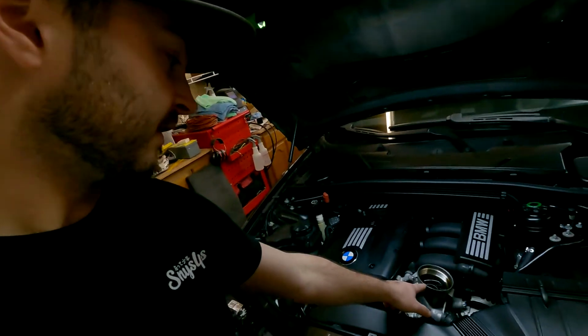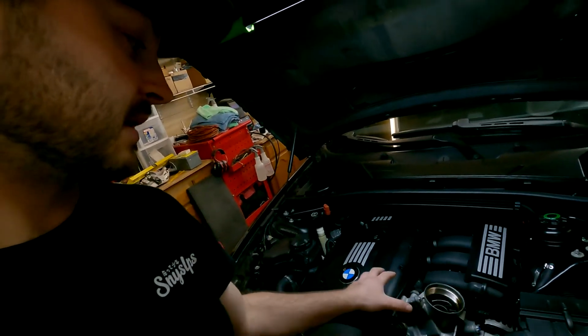So when oil pressure is running, it's going through, the screens are there to prevent any debris that may get into the solenoid itself. Now the filter is the one and only thing that filters the oil, catches any other contaminants that may be in there. But wouldn't you rather have a secondary place where any of those finer things can get caught? Here on the end of this drain plug. So by doing that, any of those small magnetic debris that may be in the engine, or maybe if there's going to be an issue with the engine that you might not immediately see at the filter when you're doing your oil change, that magnetic drain plug is going to catch it.